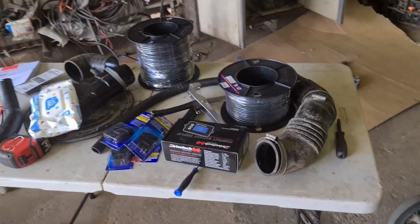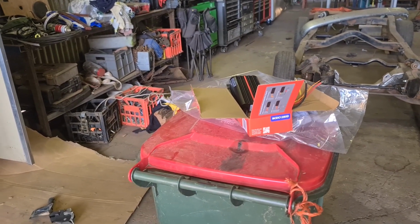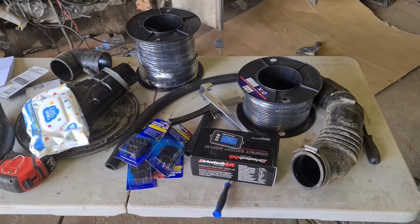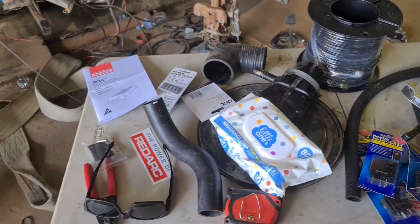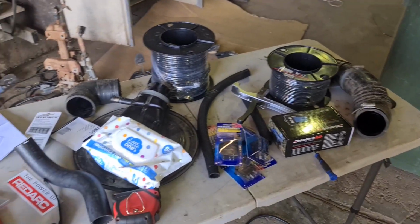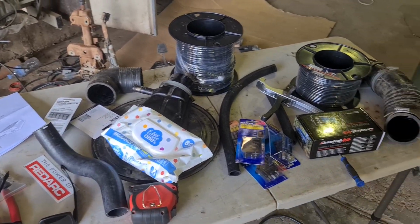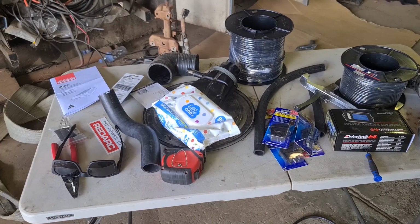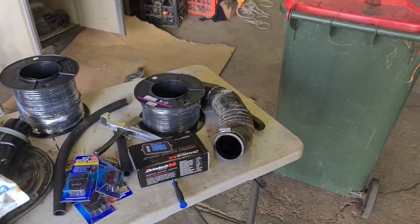So we've just finished the intake pipe. I just picked up some electrical stuff, so we've got a full 12 volt system going in, a little Drivetech screen on the switchboard and everything, and a BCDC 1250, 200 amp lithium battery from Custom Lithium, and also we've got an Enerdrive 2000 watt inverter to run the cooktop. But I'll bring you back when we get into that.